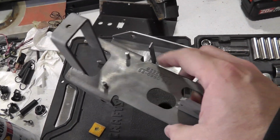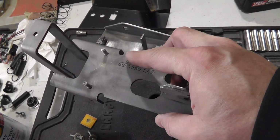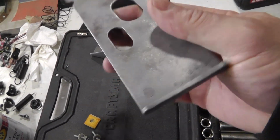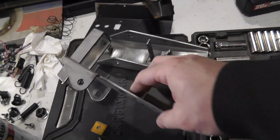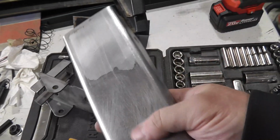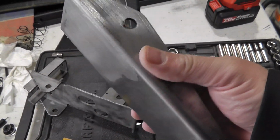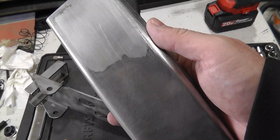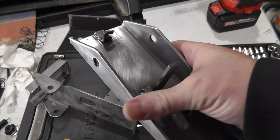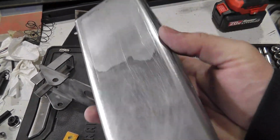When you sandblast with the black oxide, it gives it a rough kind of finish, and I think that's good for paint to adhere to it or something. I don't know, but this one here I derusted and removed all the sticky stuff with some MEK. It's nasty stuff, but you can see how shiny it is and smooth.